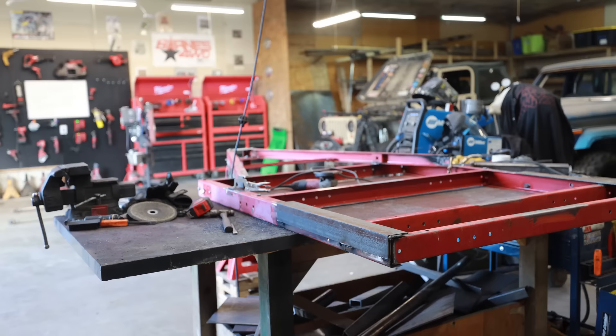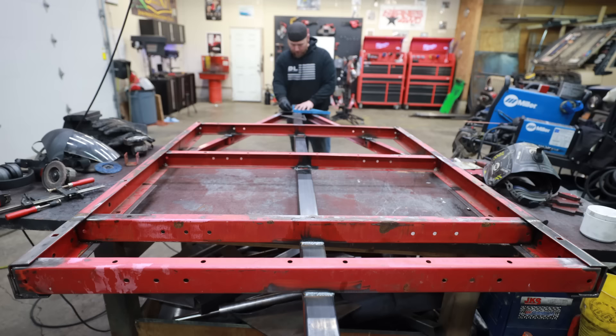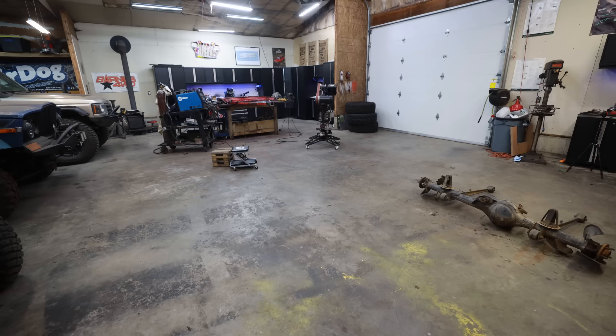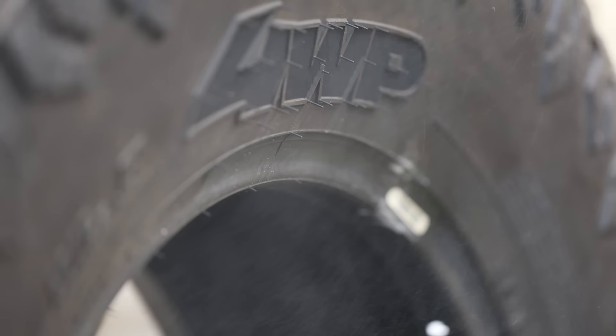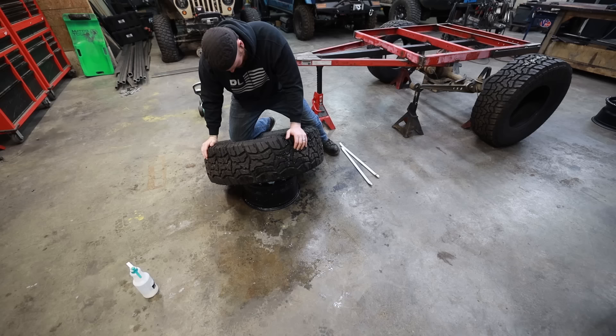I want to get rid of all these bolts that bolted this together — not because the weld is necessarily stronger, but because if we can eliminate a bolt and replace it with a weld, it means the bolt won't be able to loosen up from a bunch of washboards and have the trailer slowly start to come apart. So this step is essentially turning this trailer into one big piece of welded steel, and then figuring out how to mount a backbone — a center piece running from nose to tail — to make sure it's really strong if we need to use the trailer to pull someone out who's stuck behind us on the trail.